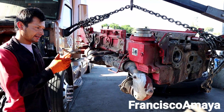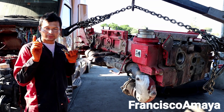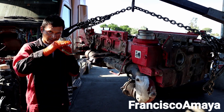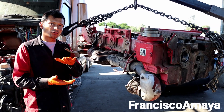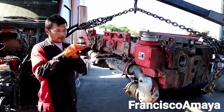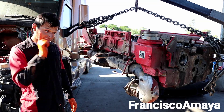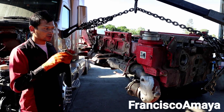Because of that, we have the head completely apart. When you have high coolant pressure, the problem happens in the top area of the engine called the head. The head is responsible for keeping the pressure of the combustion chamber sealed. When there is a very small leak somewhere, pressure gets released — in this case, into the coolant system. The coolant system was getting a bit of pressure.